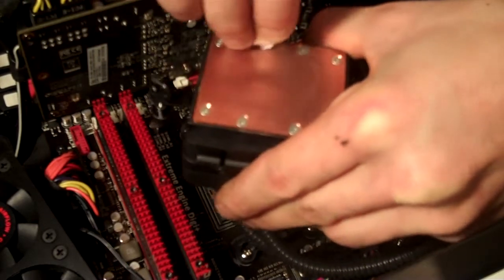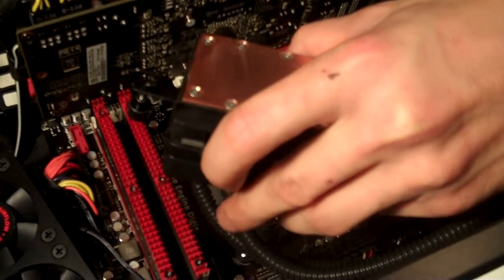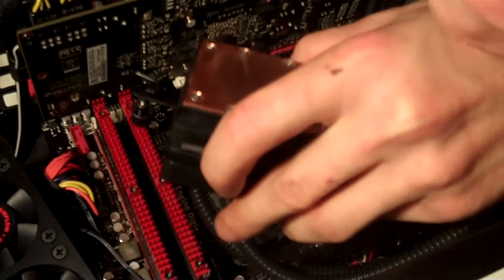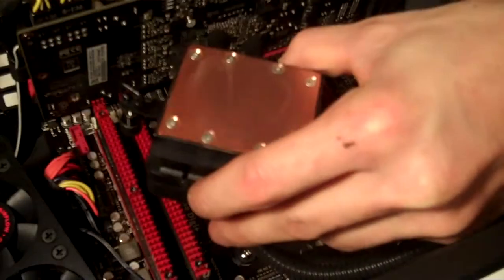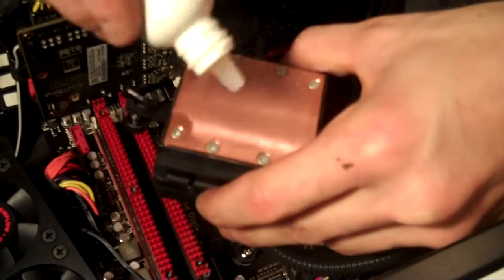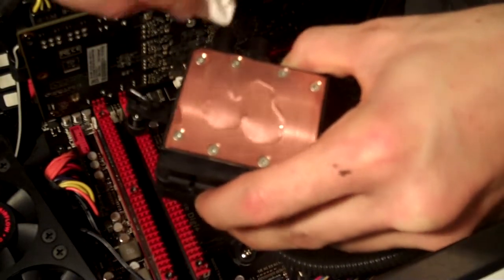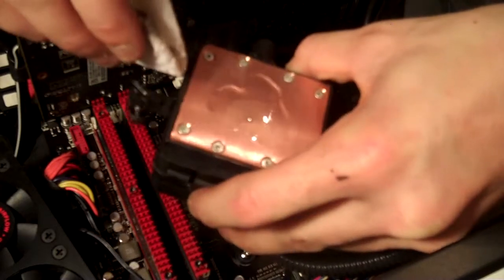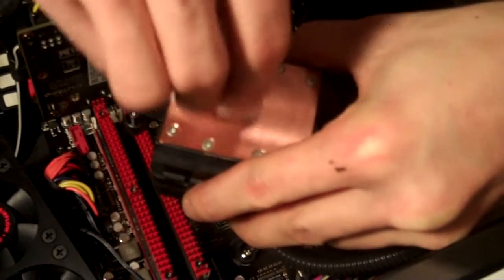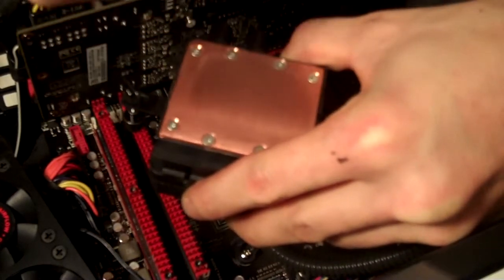You can see these screws here. Get a little bit in there. You want to make sure that the last time you go over it, if you have something like this, the last time you go over it, not to go over the screws because it will smear the compound back over the heat sink. It's the last time with the thermal remover. It's right where the CPU is going to go. Not to go over the screws.